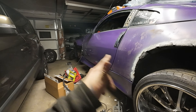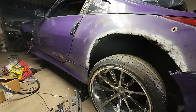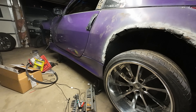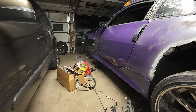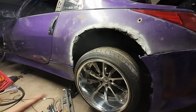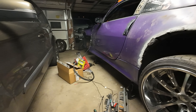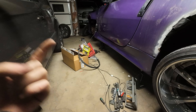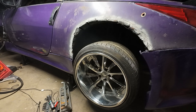Alright, so I got all four corners raised about five-eighths of an inch — that should be pretty good, it shouldn't be too slammed. We'll see how the ride height is once it's on the ground. Just as a visual, kind of like a reward — a small win — we're going to put it on the ground and honestly just look at it and see where I need to go next. Next video we'll align the car and change the brakes.